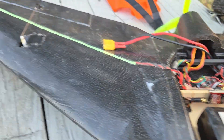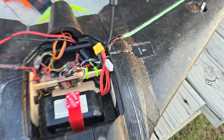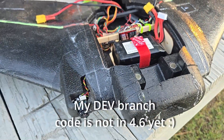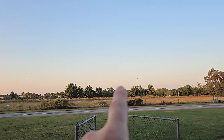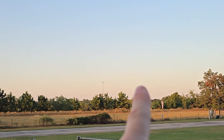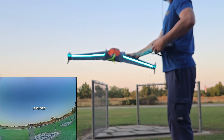This is what we're dealing with: a BetaFlight FPV wing, all horribly twisted and beaten up, glued up. It has an F722 with BetaFlight, GPS, and today I'm gonna test how the new GPS return to home for the wing works on BetaFlight. I set the home location somewhere a little bit behind these bushes, far away so that the wing doesn't circle above us. There are tall trees here and the target altitude is around 30 meters. I've got 16 satellites — I think that's good enough. Wish me luck.